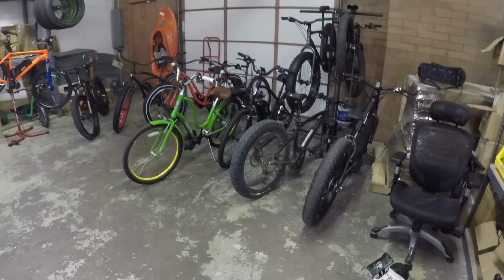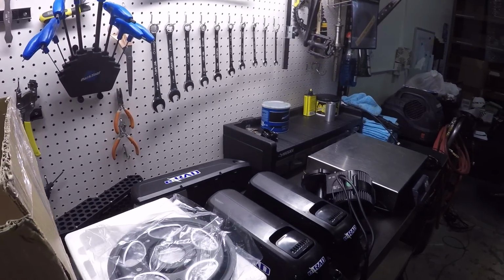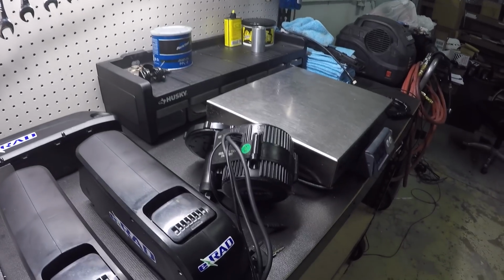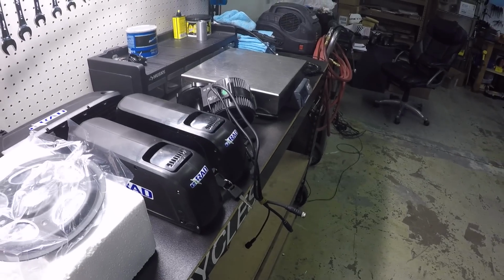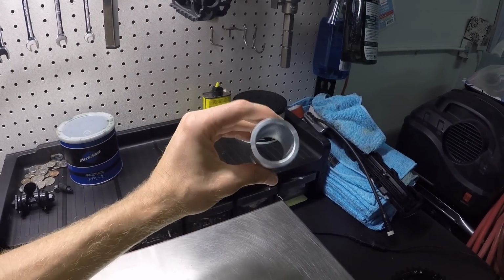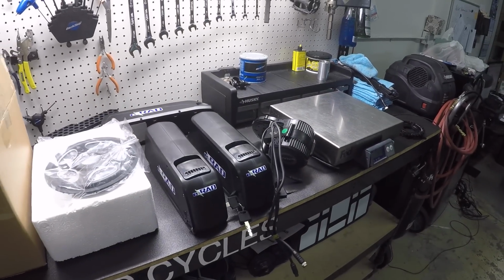Or maybe you're using, like we were looking at that Giant over there. A lot of bikes from Giant and Trek, they have the different sizes, so they also have a press fit setup. So there's a BB86, BB90, BB92, and BB95. Basically, they can make it work with that. They've done a lot of custom machine work to create this, like, kind of see that? It's like a sleeve for it, kind of like a shim, I guess, that's custom engineered so that it will fit, so that you can actually adapt this to use on those bikes.